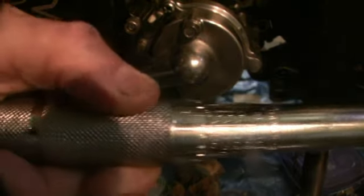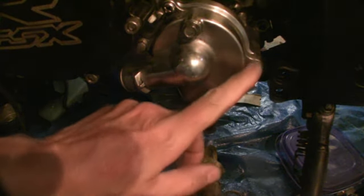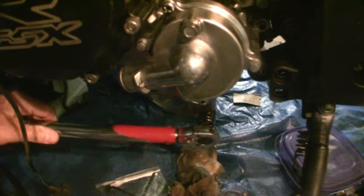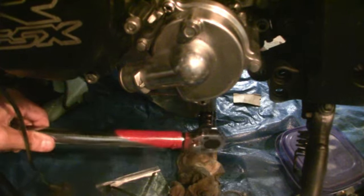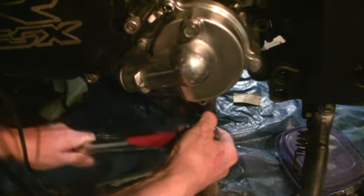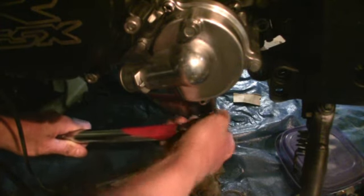Make sure you use the right side — it's the side on the back and it's hard to read. It starts at like 81 so you have to add four. I set these at 84, and set this one at 85 because it's a different size bolt — I believe it's 6 millimeter. Since I put this stuff on I felt more comfortable. Using the 3/8 drive, it's a 17 millimeter socket and it's set at 16.5 pounds. This is the oil drain plug.